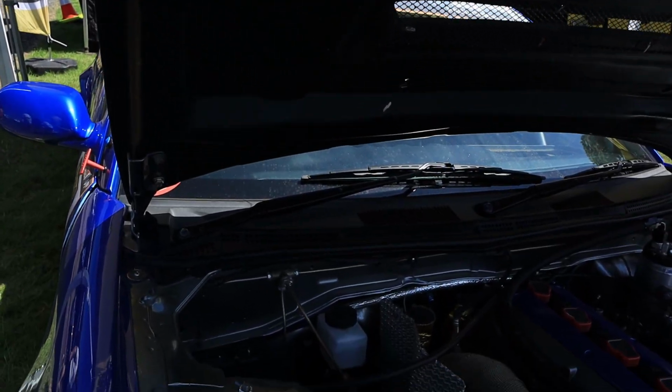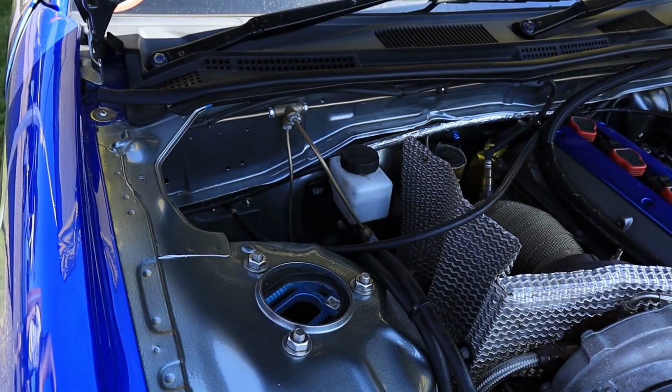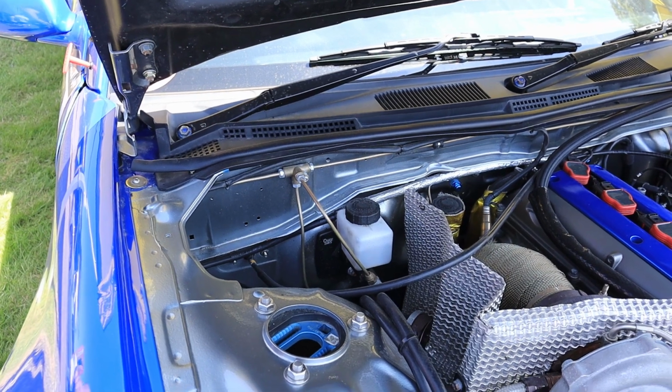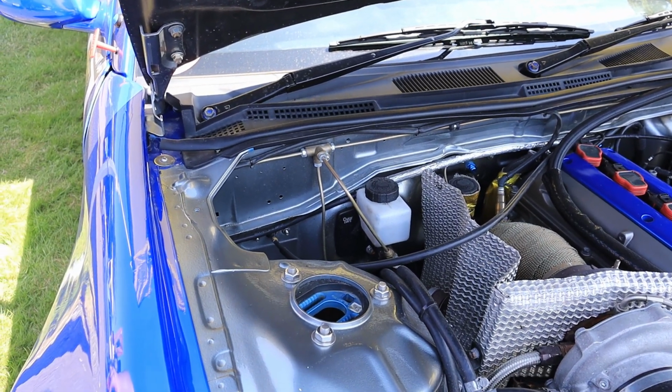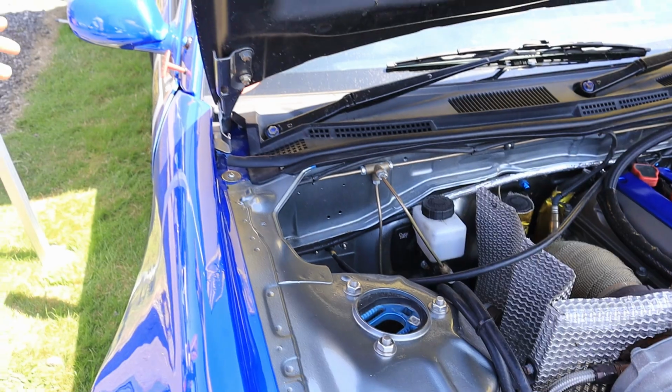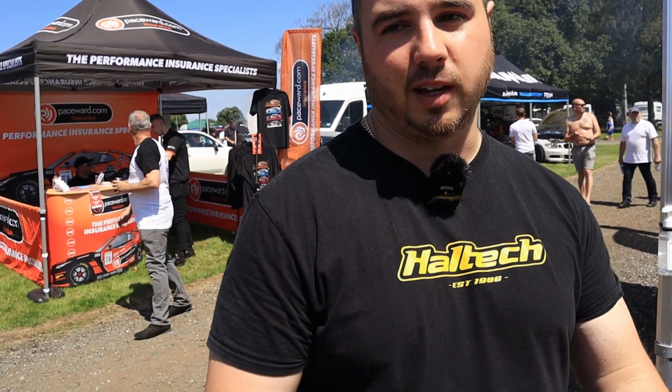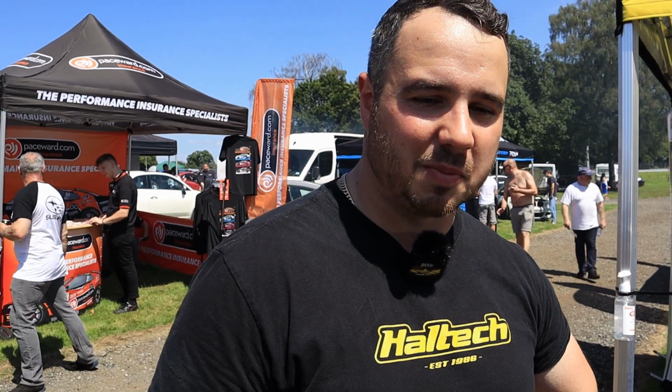So then in terms of how this is plumbed, you're still foot braking across all 4 wheels, and then you have a separate system for the hydraulic handbrake? I don't at the minute, but that is something that's going to happen. Okay. I do run a bias valve in there as well, though, so I pretty much put most of the brake in at the front wheels. Okay. But again, I do want to do a separate system on there, which should work quite nicely. That makes sense. Yeah.